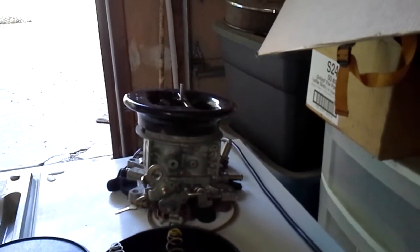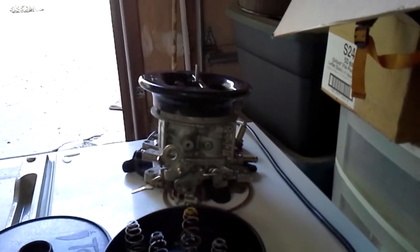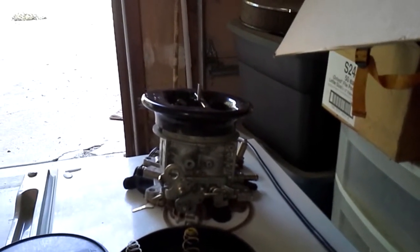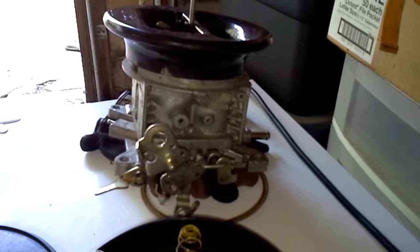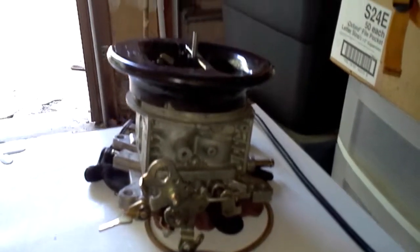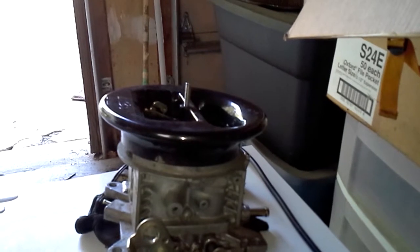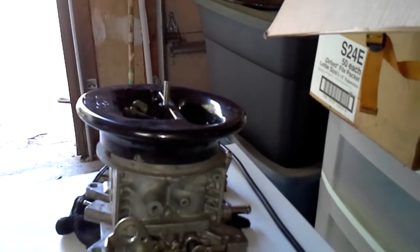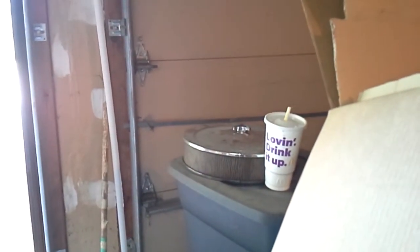I came home thinking maybe there was something wrong with my rear float, or maybe some dirt and trash got in the carburetor. It just so happens I was reading online that if you run one of these K&N stub stacks — and this is just an 850 double pumper center section I'm using as a reference — you have to run a minimum of a 4-inch air cleaner. They recommend 5- to 6-inch elements. I've only got a 3-inch air cleaner on there. I bet that was causing the problems.